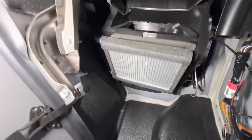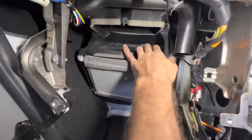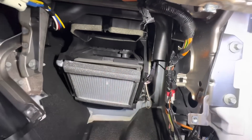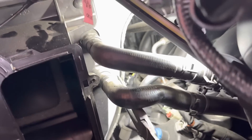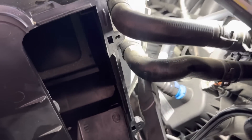So now I've got to go ahead and pull the coolant lines off this heater core and get this thing out so I can get the rest of this box assembly out of here — and then get the other box assembly out of there. We didn't have to double capture that stud, guys. We could have done better. So let's see if I can get these little clamps loose and pull this heater core out.